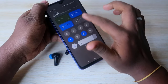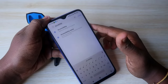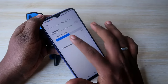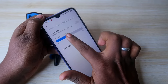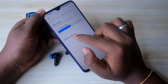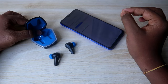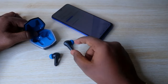There is also an Android setting to check. Go to your phone's Settings and search for Accessibility. Click on the Accessibility option and find the Hearing section. There you will see an option called Audio Balance. This audio balance should be in the center position. If it is towards the left, you will only hear audio in the left earbud; if it is towards the right, you will only hear audio in the right earbud. If this option has been changed, you may experience volume imbalance issues between the left and right earbuds, which can be solved by centering it.